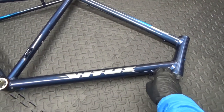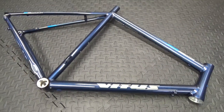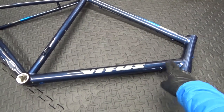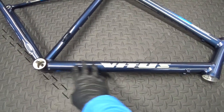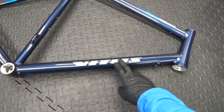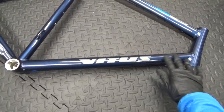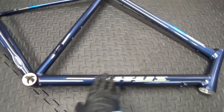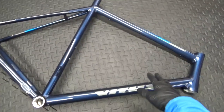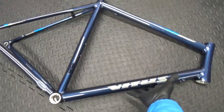This is an aluminium frame as I said. Being aluminium, you could get it blasted, but I don't recommend that because it can damage the actual surface of the metal and leave a rough finish. If you've got nice paint on your frame you can just flat it down with some 800 sandpaper to dull it and do a quick repaint over it. But the best way is to get rid of all the old paint and start from bare aluminium, so I'm going to paint strip this frame.